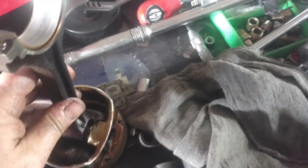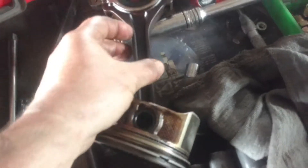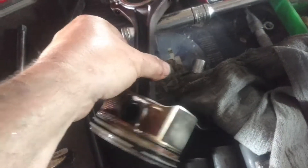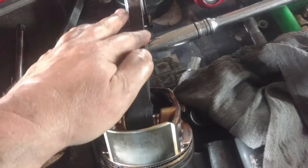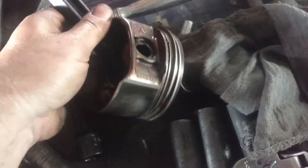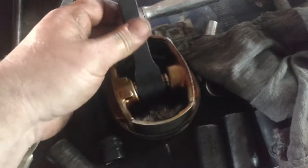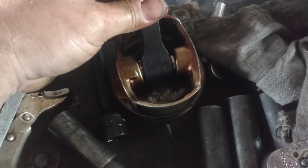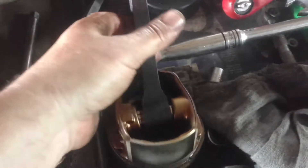Something I did want to show you: I ran a straight edge this way and then this way to make sure that connecting rod wasn't bent, which I didn't think it would be, but it's straight as an arrow. Changing that piston won't be a big deal because those are snap rings on each side. You can see the connecting rod moving and the wrist pin stays there — the wrist pin is not pressed in, so that'll be simple to change.